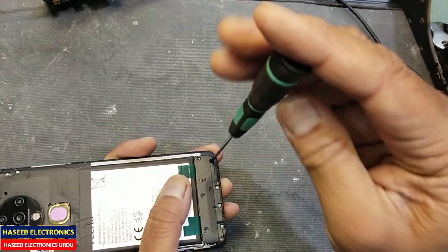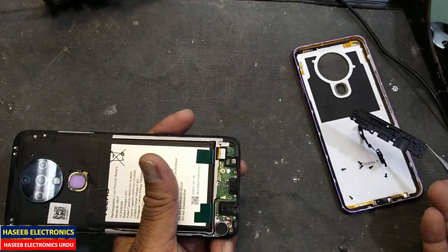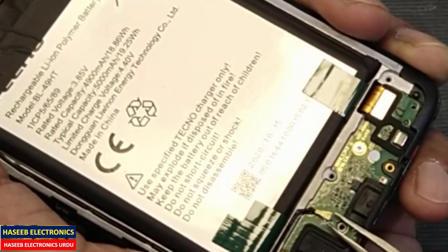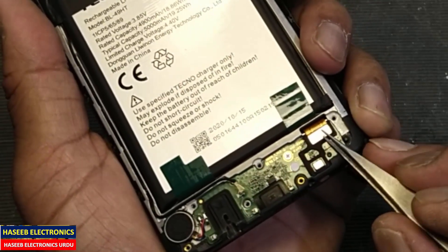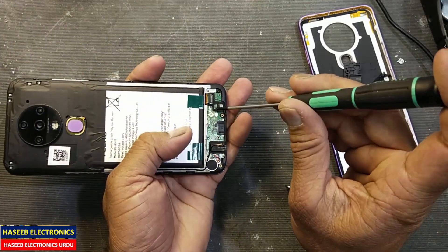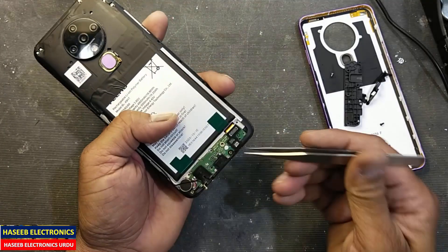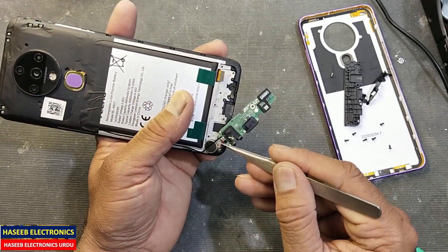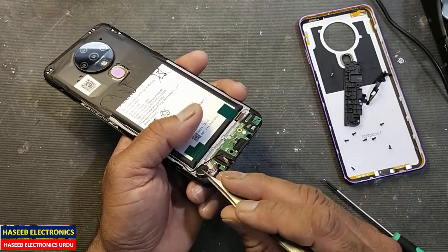Now I am opening this screw. Now you can lift up this cover very easily. Now I will remove this flex connector very carefully, and then we have to remove this connector — this one and this one. Now I will remove this PCB screw. After removing this we can lift the board very easily. You can remove both connections of the speaker, or you can lift the speaker with the board — whatever you want.